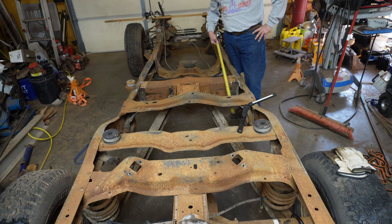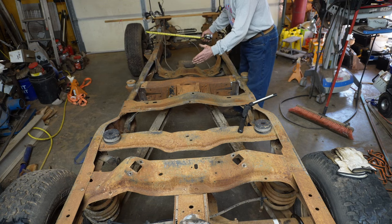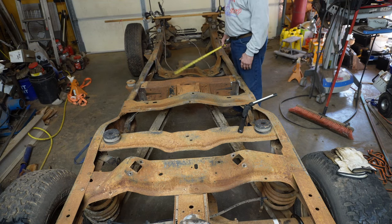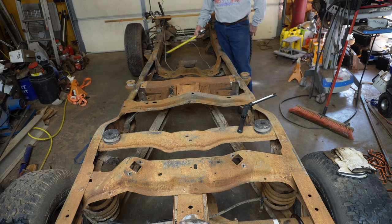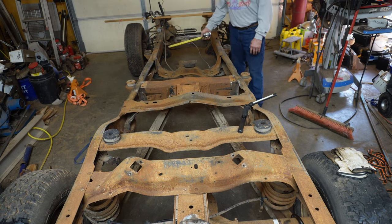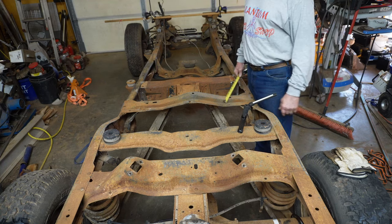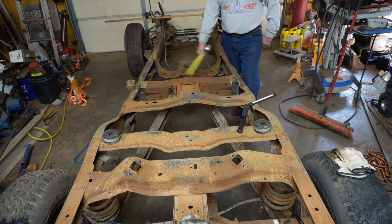Well, the leaf springs are all connected underneath there, riveted and welded, and that turned out to be a problem. So what you end up with is you need to make a trapezoid taller. And the only way that works is if you bend or stretch, or if you open up the trapezoid to make it work. Perfectly reasonable way to do that. You weld it in, you sleeve it, you weld it together, it's not going anywhere. The more I thought about that and trying to come up with the right sleeve, this is 2.5 inches by 5.5, that's not standard, so you gotta come up with a way to make the sleeve. Again, it's doable. Then it occurred to me, I'm a Chevy guy. I got a lot of old Chevys. I like this trailing arm suspension.